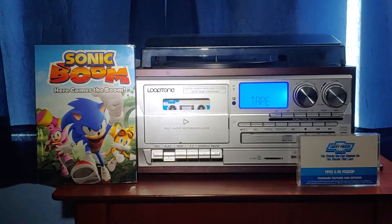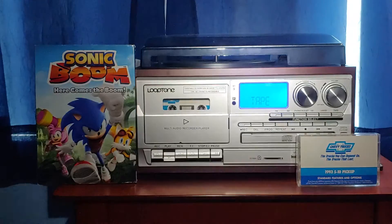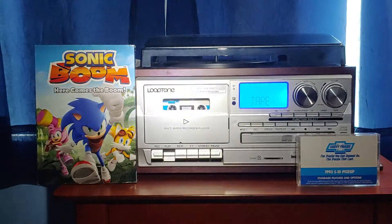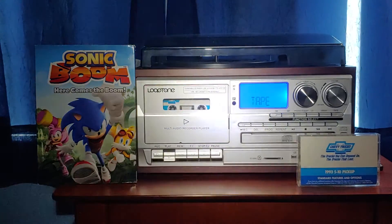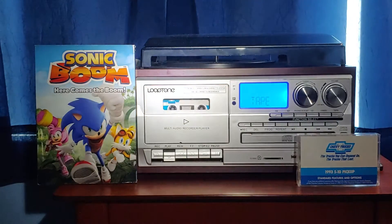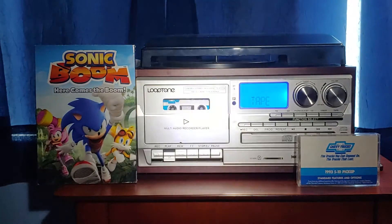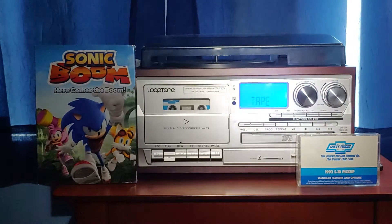If you have air conditioning, its operation is discussed on side 2 of this tape. On non-air conditioned models, your new pickup is equipped with easily operated ventilation and heating controls. To allow outside air into the interior, simply place the heater control in the vent position. Additional air vents are located in the kick panels, opened or closed with handles on the vents. At the top of the heater control system you'll notice the heater fan control. There are two slide levers on your heater — the right slide lever allows you to select any of the modes, and the left slide lever allows you to adjust the temperature setting. The defrost mode directs most air to the upper defrost outlets, the heater mode directs most air to the lower heater outlets for maximum heating, and the vent mode directs outside or heated air through the instrument panel outlets.